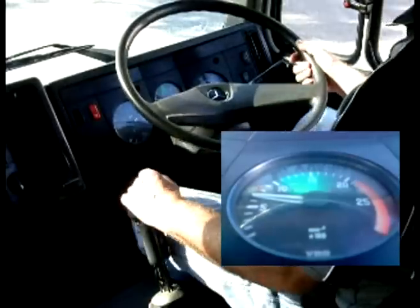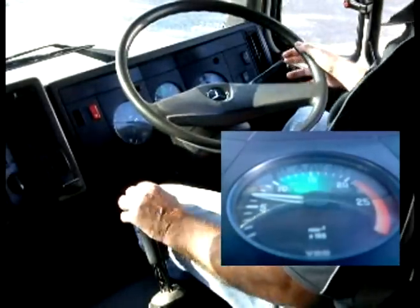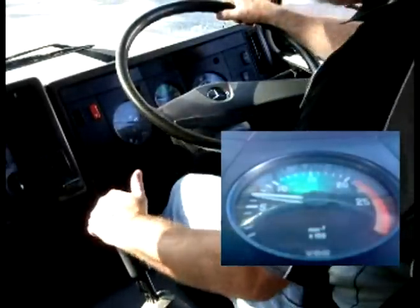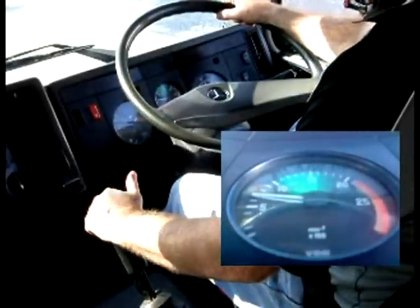All right, hard gears now, so moving up the first gear and splitting each gear. Mirrors and signals, move off. Take a second to let the gearbox slow down. Work the gear in slowly, gently.